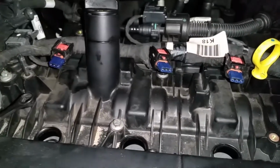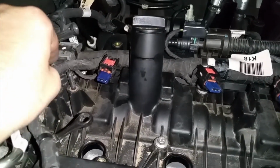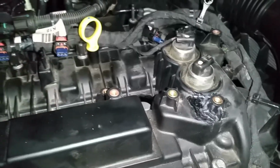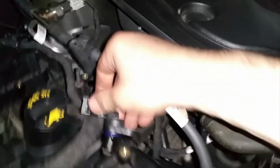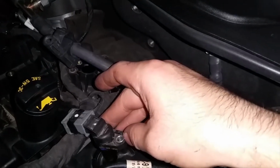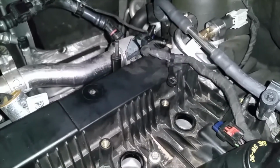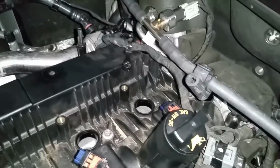After we're done taking off this guy back here, there's another plug back here. You gotta take off that hose. You gotta take off this guy back here as well. You're just taking the wire off of it. And these two holes that you guys are seeing right here is your oil pressure sensors. Just gonna go ahead and take those out of the holes. You can remove them by one 8mm screw on each one. There's one on this side, and there's one on that side as well. As you guys can see it hanging right there. So you just want to get those both off.